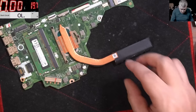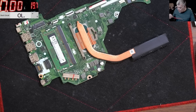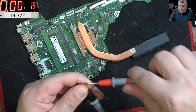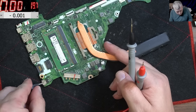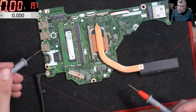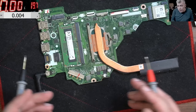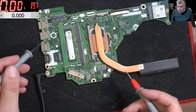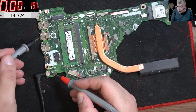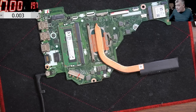Let's test it before fitting the board back. Let me grab the original charger - it's actually a power supply, but people call it a charger. We have 19.3 volts on the charger. Plug it on the motherboard - take ground from anywhere on the board and probe plus. On screen: 19.3 volts. On any laptop, if you take ground from any metal part of the motherboard and see voltage, you know the charging port is good. The job is well done.